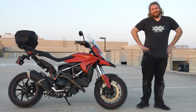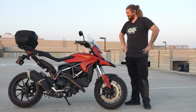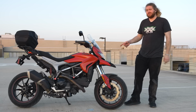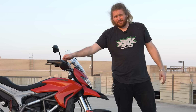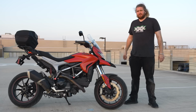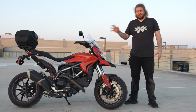Oh God. Okie dokie. Feel like I got a sunburn and I still haven't gotten the seat on the motorcycle. Not sure what's going on there, but the important stuff is done. We do have fresh oil in the motorcycle. We've got fresh brake fluid in here, and we got rid of that nasty Gumby crap that was in there. That was seriously the nastiest brake fluid I've ever seen. I've never seen it be glue like that. Really weird, and it's why you should be doing your brake fluid more often than just every 2 years.